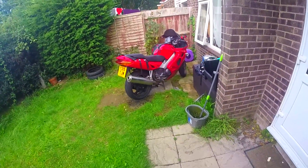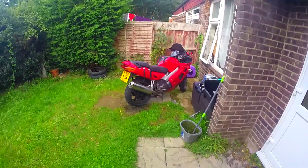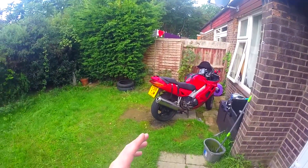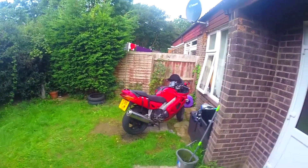In order to discover what that fault is, I have to go through every single piece of wiring on the bike. Including, don't forget, the negatives, or the earth, the grounds, because most common problems usually start there, so I'm going to have to clean up every single ground today.